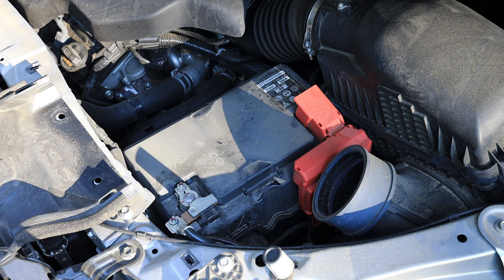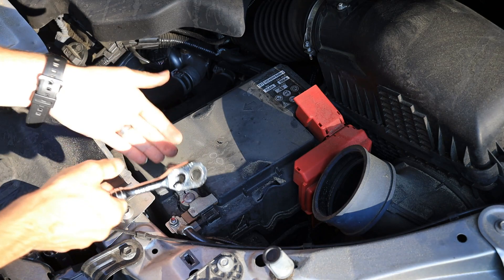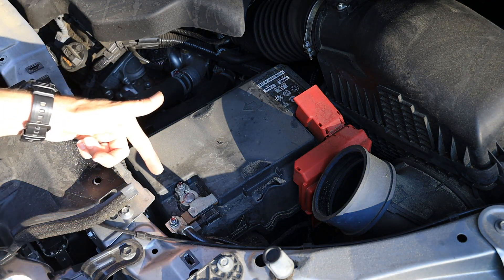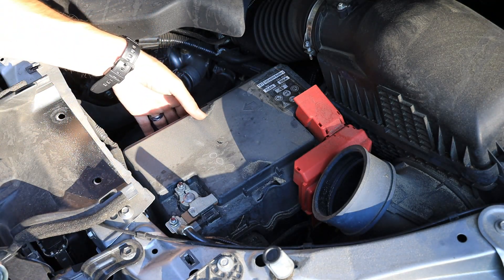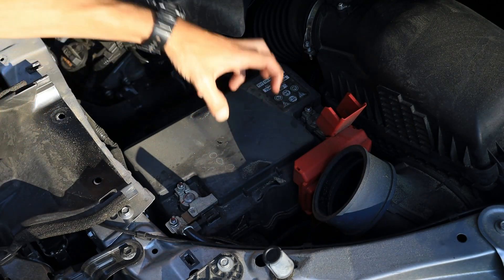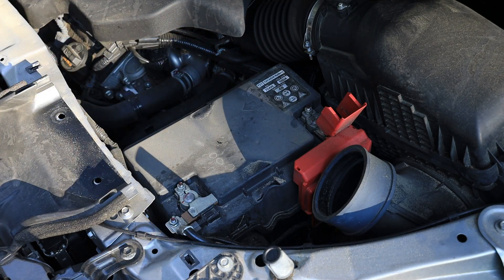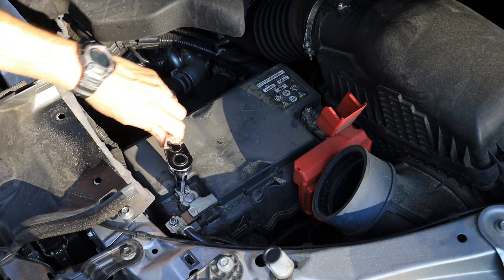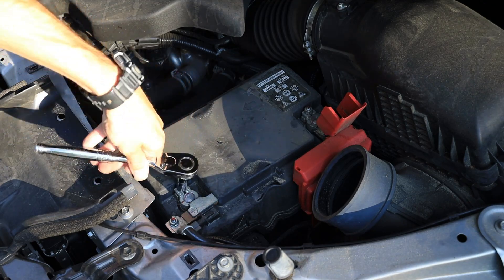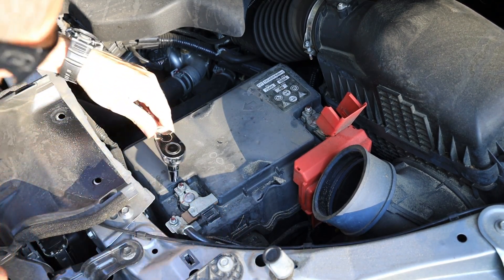Next thing, you're going to want to disconnect the battery. You always do negative first for everything. So when you disconnect the battery, you want to do the negative first. And then when you reconnect it, you put the positive first and the negative last. So negative is the first you remove and negative is the last you put back on. These Honda batteries from the factory have a plastic cover that you have to remove. The battery is sitting in a battery box — this box is going to be from Honda, and you're going to reinstall it over the new battery. Whenever you're handling a battery, you should be wearing gloves and eye protection just in case there is acid in the battery.